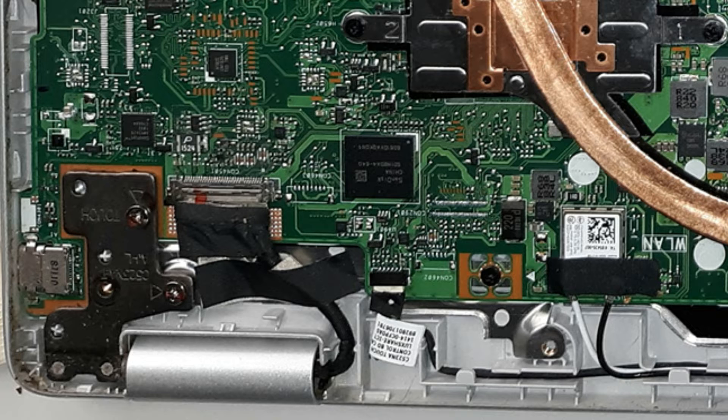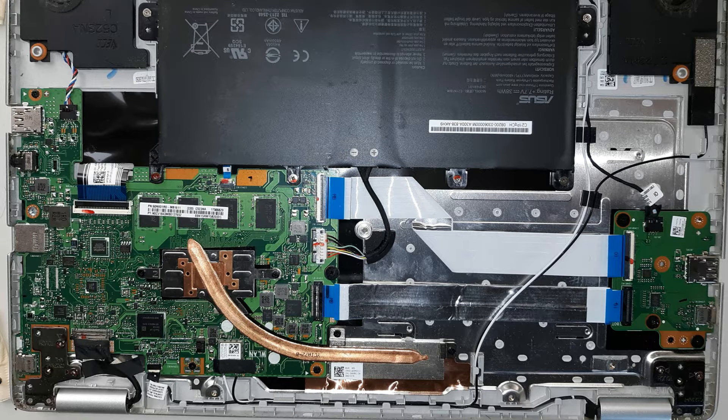Next to the display port we find one of the hinges. Chromebooks have two of these hinges, and over time with opening and closing the clamshell, guess what — these screws can become loose. I've had customers bring me their Chromebooks with hinges that are not securely fastened, and I've had to tighten these screws. That's another reason why we open up the back.